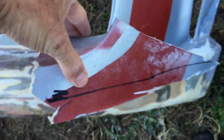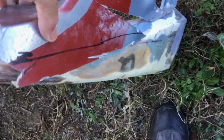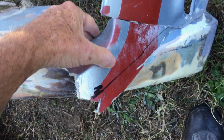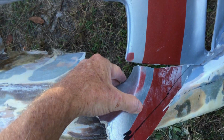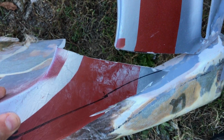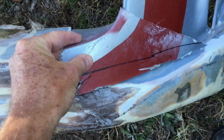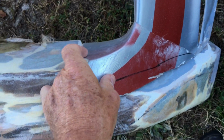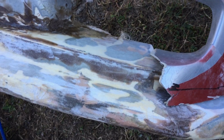I think I left it over here, right here. Okay, so I had to take this piece out right here in order to shorten it, because it's too low and I keep busting it. And it's like the third or fourth time I've had to repair this bumper. It's just too low for everyday driving. So I'll have to trim this to proper size and slide that back in there, and then fiberglass, and then epoxy it back in, and it'll be done. Alright, it's kind of time consuming because you got to wait for the resin to set up before you can sand on it anymore.